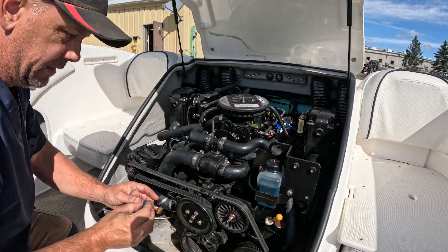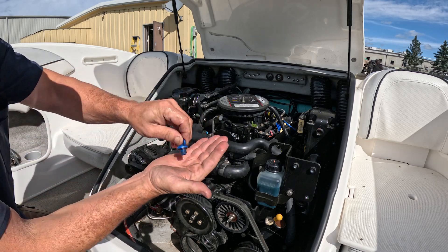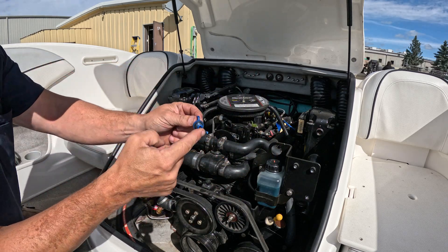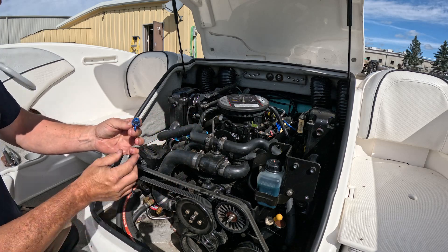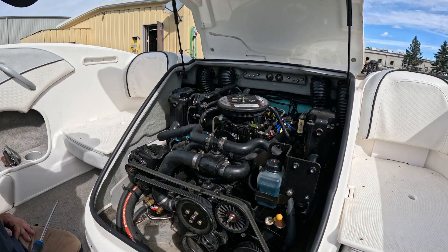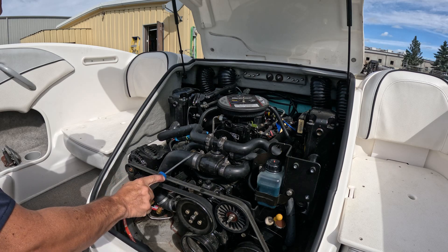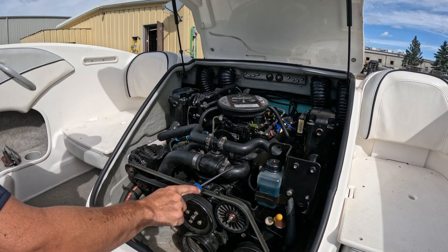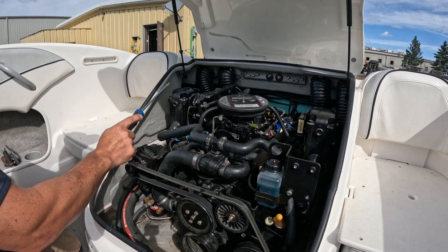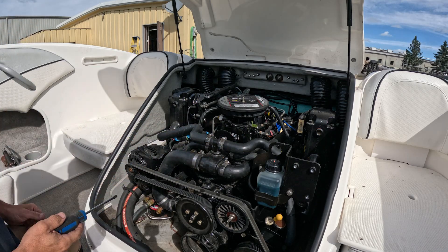Now this particular one — I think this one was down on the front — we can see some scaling inside. That can build up in the engine, and we're lucky that we've got these large holes because anything that's in there should dislodge itself as the water pushes through. Once we've confirmed that all the water is out, we want to take off this hose and this hose. We can take these hoses off if we like, but ideally if a lot of water came out and we seal them back up, in most cases they're going to be fine.